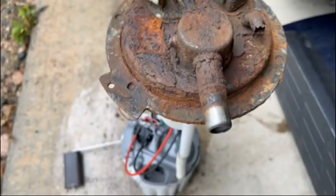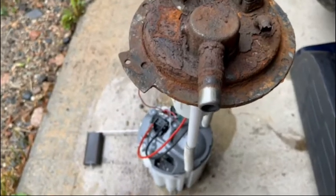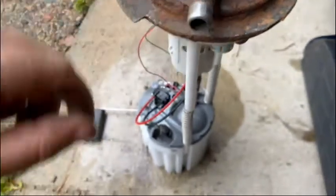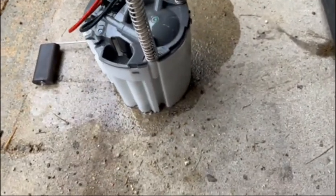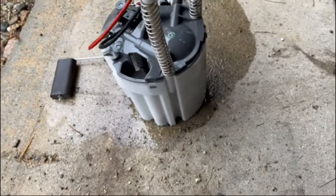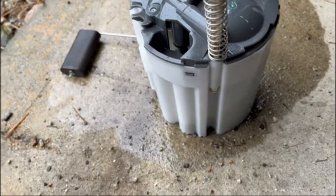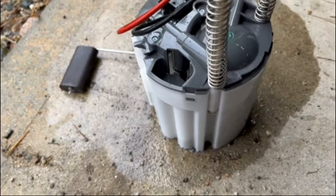I did this on my old 2005 Chevy a few years ago so I kind of had an idea what I was doing. Keep in mind you've got a bowl down in here — shake it a little and you can see it — there's gasoline in there, so you want to pour that out into something, probably just pour it right back into the tank.